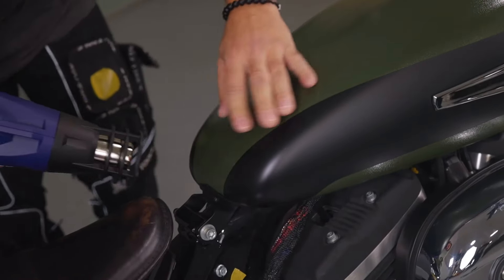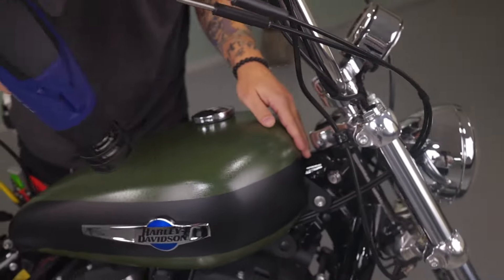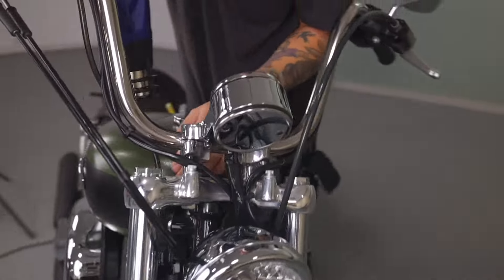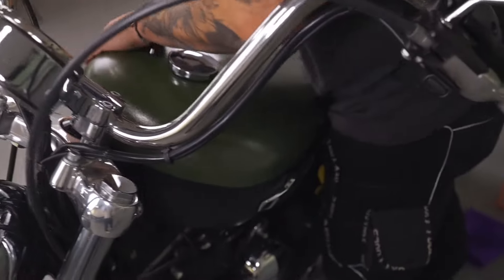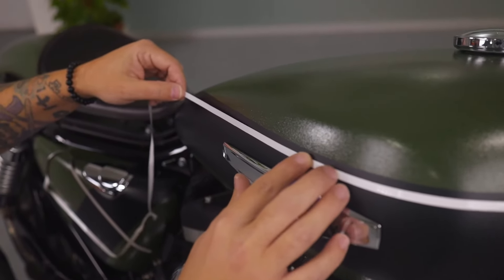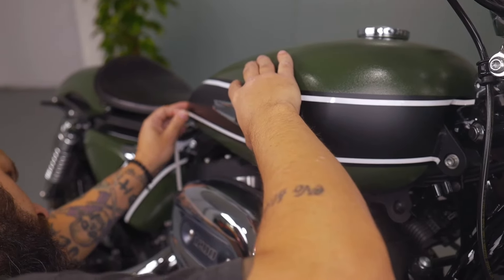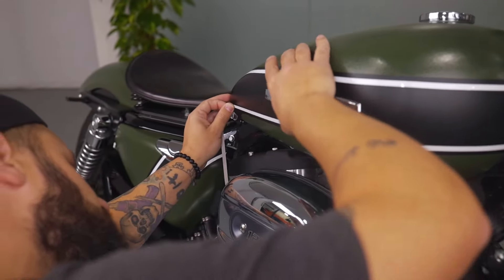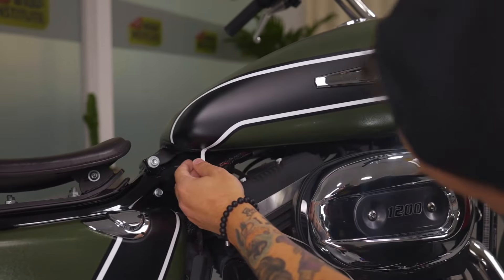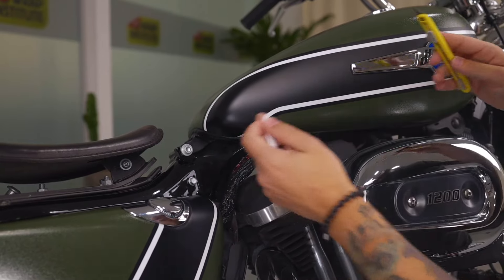The final step for the main piece is to do a 360-degree check with the heat gun, just to make sure all edges are fully sealed and the adhesive is activating on the surface. Then, as a finishing touch, add a white stripe to the top and bottom of the negative area to create an extra custom look — focus on symmetry, maintaining a perfect quarter-inch gap just above or below the green, then cut away the excess film at the ends.